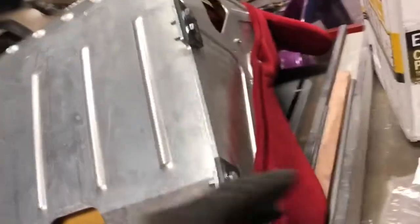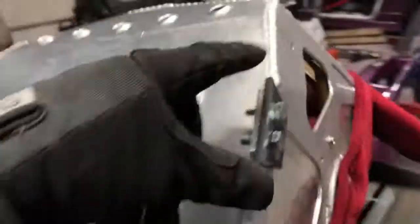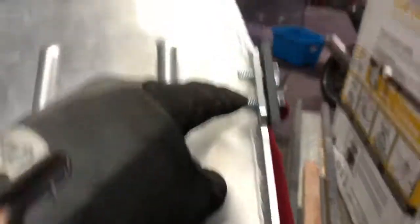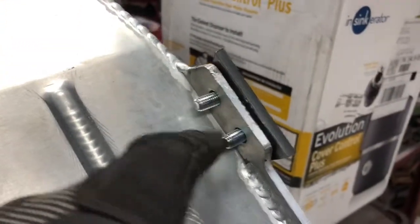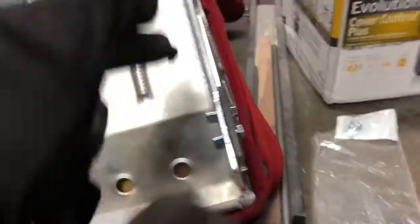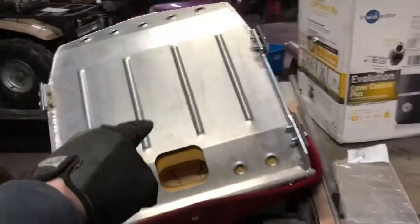I'm going to test fit again because I'll be welding these partially in the car and I don't want to burn this cover - it's in really good condition, only one little tear. These are the brackets that are going to be welded to the rails. The stock mounts only use one of these holes but I might as well use two - it's a much bigger tab, so I have more surface to run a bead and eight bolts rather than four, which should be more secure.